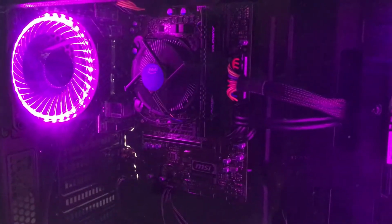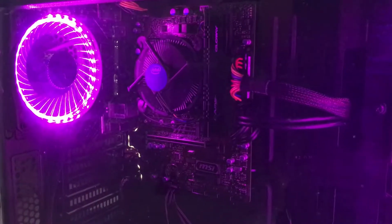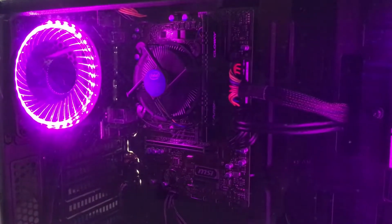However, I have an experiment, in case you want to know what will happen if you only have 3-pin fan headers, and you still want to run these fans. What that means is, while you can run them, they will all be running at full speed all the time.